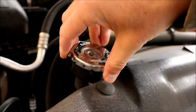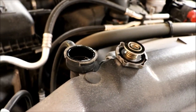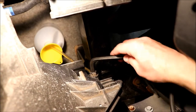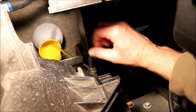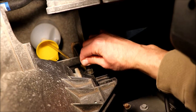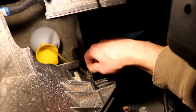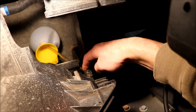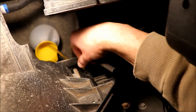I'm going to open up the radiator cap so we don't get any vacuum — that way it should drain pretty well. I've got my 10-millimeter hex in here. It's very snug from all the dirt, so it's hard to get out, but it's not very tight. It doesn't take much to break it loose. I'm hoping everything drains through the hose — sometimes that's not always the case.